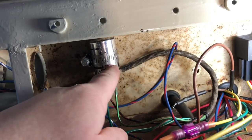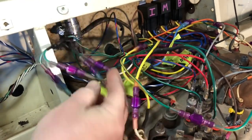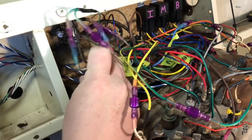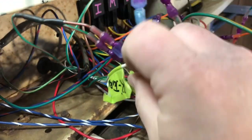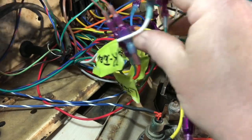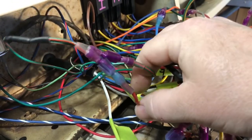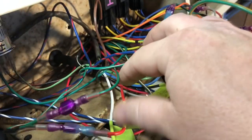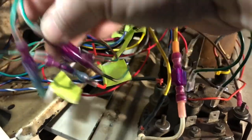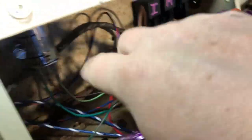The green wire coming from the fuse box powers up the turn signals when you turn the key on. The pigtails: one goes to the front right and the other goes to the back through the brake harness bundle wire. I tagged the wires instead of adding color-coded pieces — that's good enough. Red was the left turn, and on the wiring diagram L is the turn, so those are connected to the front and rear for each side. It's organized chaos but everything is hooked up.